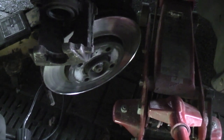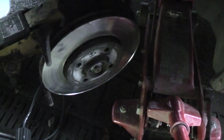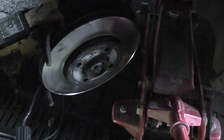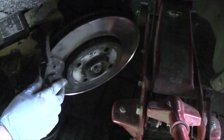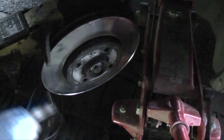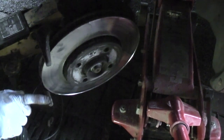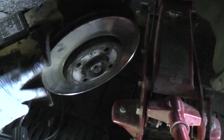I'm going to use a cable tie and tie the caliper up on a spring, out of the way. The cable tie is taking the weight and not the brake hose. Here's the pad — the pad fits in there and should move in and out on these two sliders, which are all rusty. So I'm going to file these up and give them some copper grease. Then remove the disc, clean it all down, put the new disc on, and then we're ready to put the pads in.